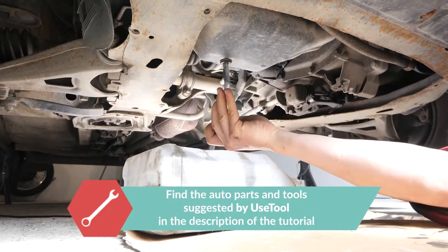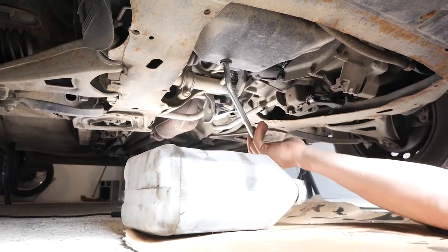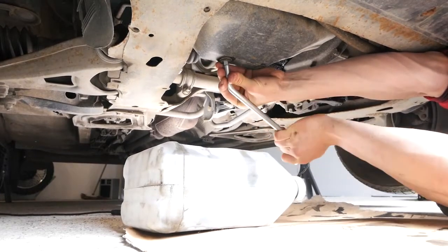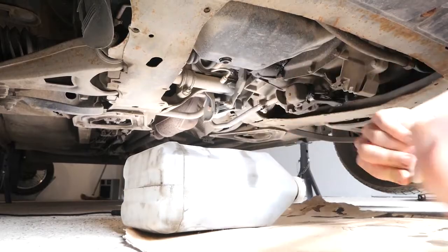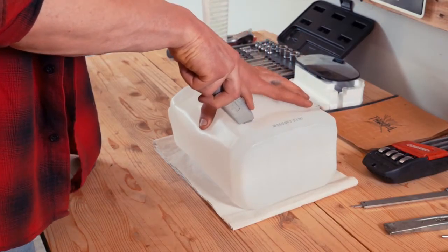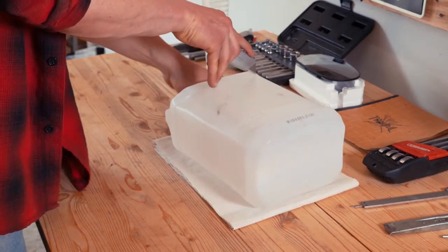With an oil sump spanner, a vital tool which allows you to unscrew the drain nut, unscrew the nut. Make a single quarter turn and remove the key. Don't forget to place a used oil collector beneath. You can learn how to make one by watching another of our videos, How to Make a Collector for Liquids.